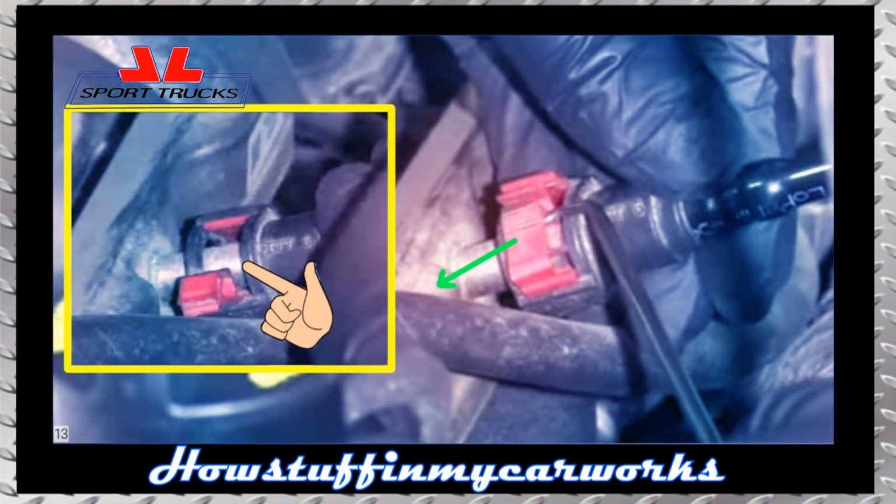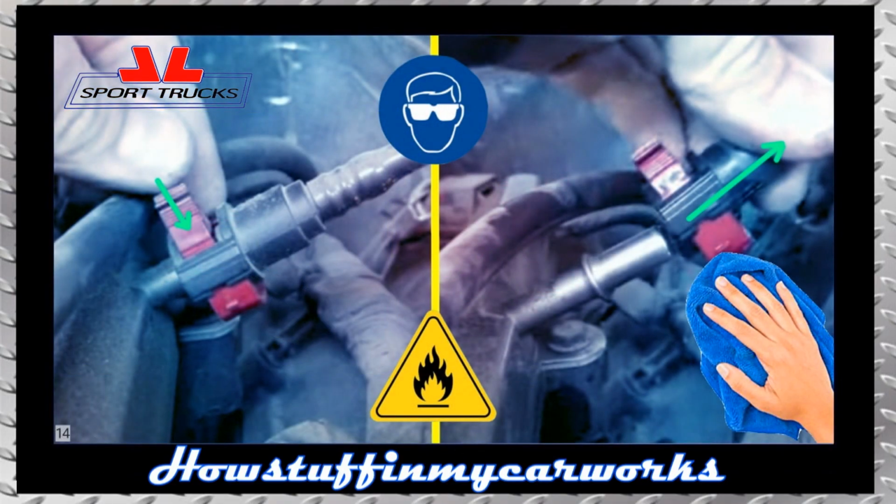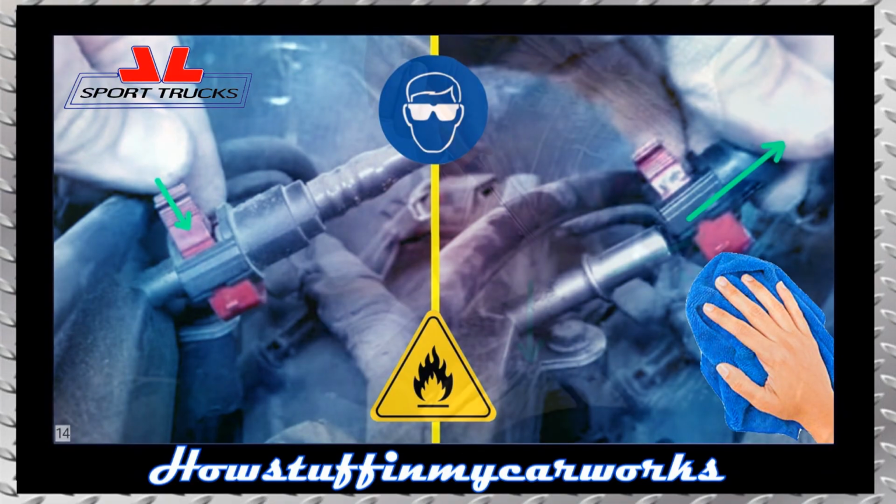13. Release the fuel line connector retaining clip by prying up on the retaining clip with a small hook or flathead screwdriver as shown on the screen. 14. Next, apply downward pressure to the end of the connector retaining clip to make it easier to disconnect the fuel line. Place a second towel over the fuel line to avoid spraying fuel on the engine components or yourself. Pull the fuel line straight out by hand to completely disconnect it as shown on the screen.